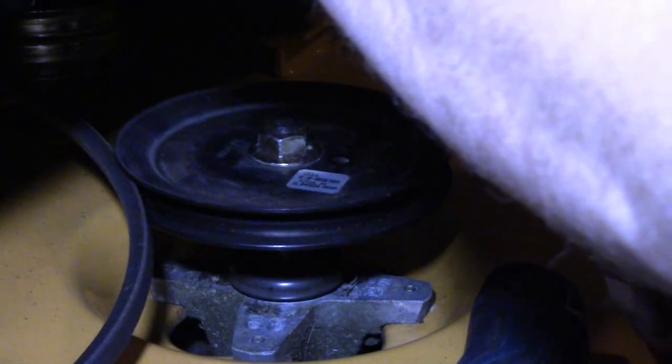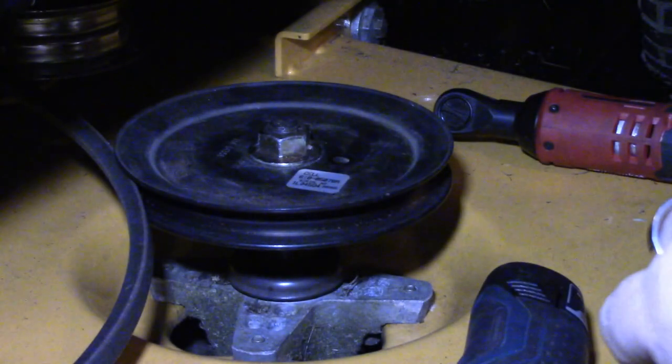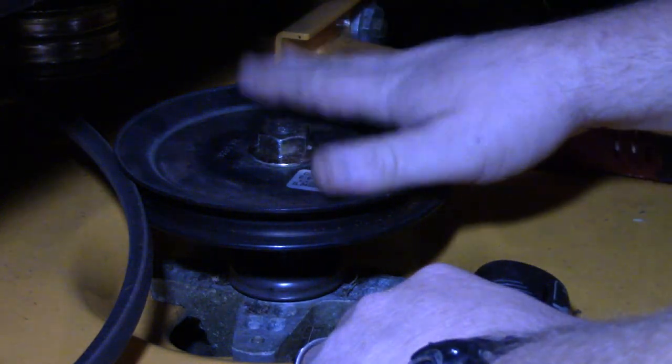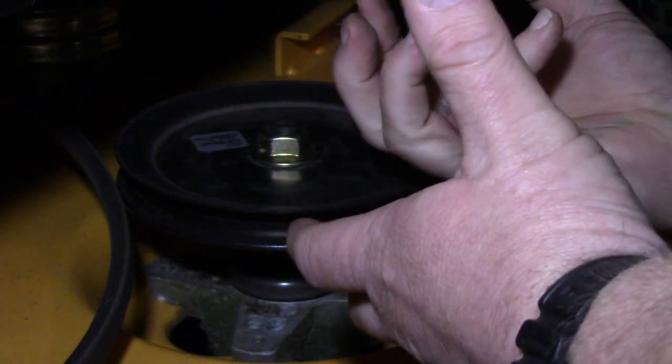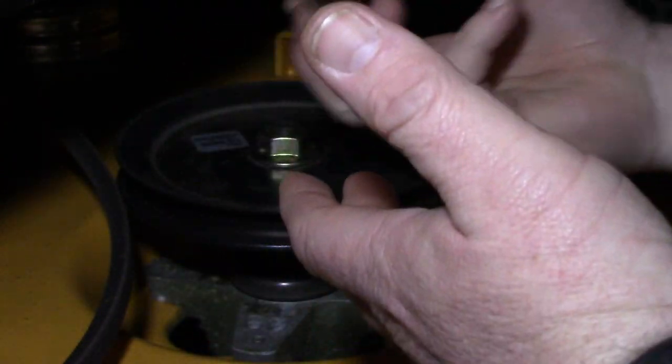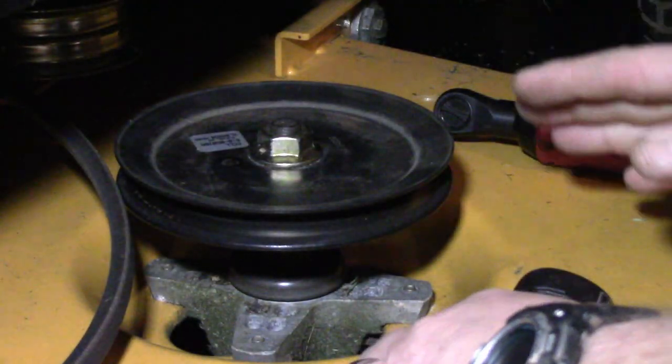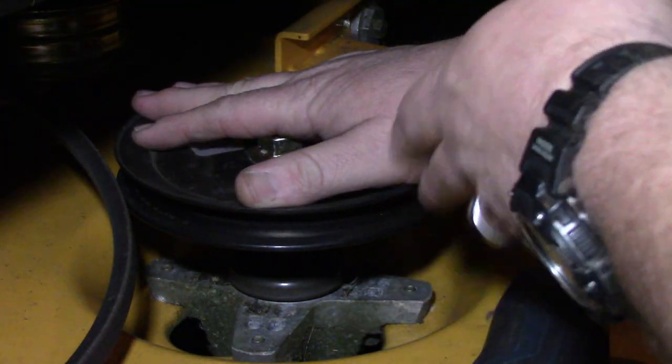In the next couple of days I'll get my new ones. This is my normal winter preventive maintenance on my zero-turn, my Tank. This is what I wanted to show you — test your spindle, because a lot of people say 'I don't hear any grinding,' but just because you don't hear grinding doesn't mean the bearings aren't shot. It could be out of round, wobbled, shaft twisted, the attach bracket warped, or blades misaligned if you put the wrong style on.